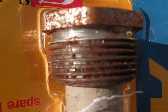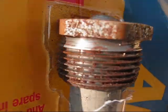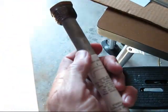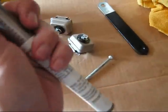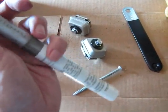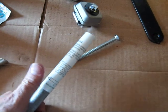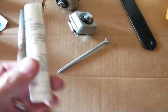The longer you let this go on, the more chance you have that the anode will leak when you install it. So you want to stop this corrosion if you like to stock a spare part with your trailer. One other thing you'll notice with your anode once you get it out of the package is it has this little notice on it. This actually has a very important note about the manifold and the orifice that's in the manifold — it says don't lose the orifice, or you can get too much gas into your heater, which can make it go nuts and burn your trailer down. So that's an important little safety message.